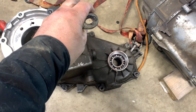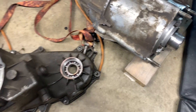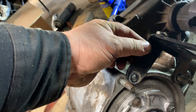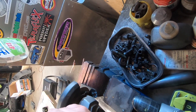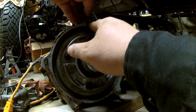I'm gonna bring this bracket in just to align it up. It's going to go straight in — this bottom pin right here is pretty much the same spot as this one here. So as long as I follow the same angle, I just have to cut that top bracket and weld a spacer so it goes up to that top one. I think we'll be good — famous last words. I'm gonna bolt the brackets on and see where I'm sitting to make my little jumper piece.